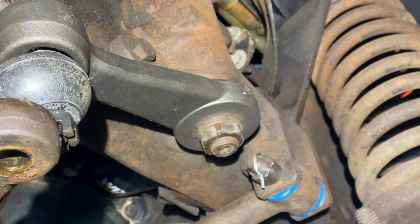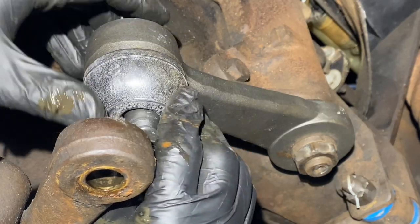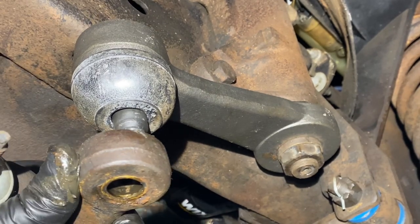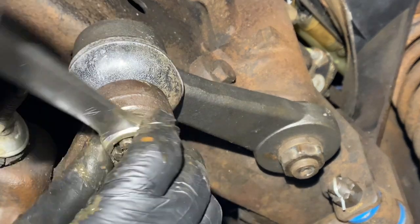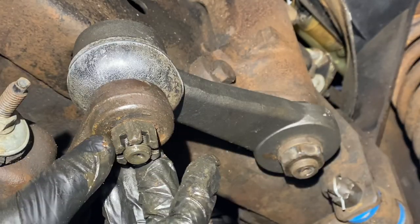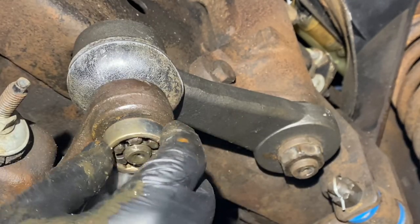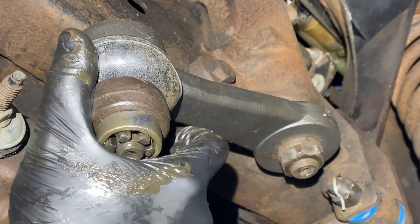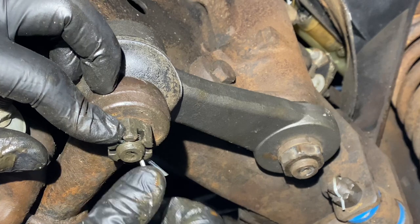The socket isn't really turning that much anymore, so it's good and tight — it's not going to go anywhere. Make sure your boot's pushed up good, and now we can put our arm back up, put our nut on, and tighten it down. You don't have to over-tighten it — this is a wedge fit, so you want it snug. Don't leave it loose because that could be catastrophic; just tighten it up good with good tension on it, line your hole up for your cotter pin, and you'll be good to go. Take your new cotter key, slide it in the hole, and bend it around.